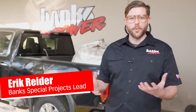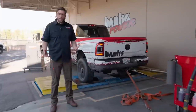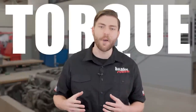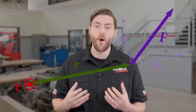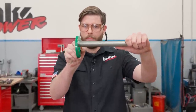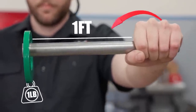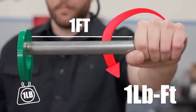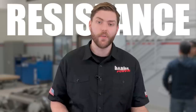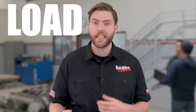Before we get into dyno results, we're going to take a look at the dynamometer itself. A dynamometer, or a dyno, is simply a machine that measures torque. Torque is the amount of turning force applied to an object or surface over a given distance. It's often measured in pound feet. So if I put a one pound weight at the end of a one foot stick and held the other end, the amount of turning force on my wrist will be one pound foot. As an engine on a dyno turns, it's applying torque to find out how much torque the dyno resists. And that resistance, often referred to as load, is measured and corrected to give us a torque value.